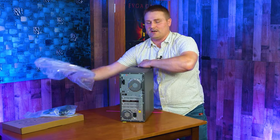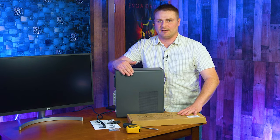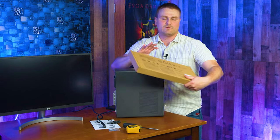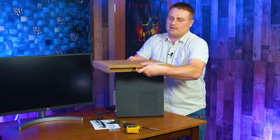This thing does come with a 400-watt platinum power supply that will support up to a 2060 Super or a 3060 Ti. The memory in this is upgradable to 32 gigabytes. That's an overview of this PC. The other M.2 slot in here is for little cards only — it will not take a second M.2 hard drive. Real quick about this wireless keyboard and mouse — I'm going to show you what is in here.